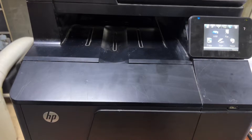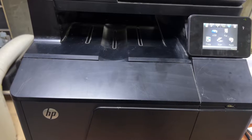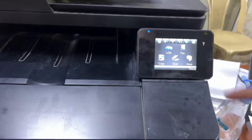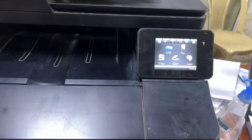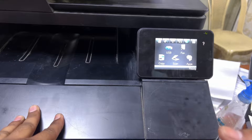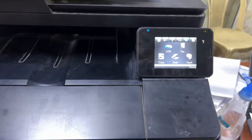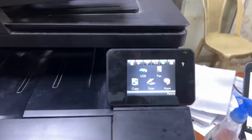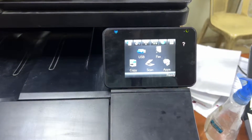We'll clean it and fix it back again, but there is a process. If you want to remove the feeder roller, you cannot do so until you bring your printer into secondary service mode. Then we will systematically rotate and remove the feeder roller, disconnect it, and then fix it back again. Watch this step to see how to bring this printer into secondary service mode.